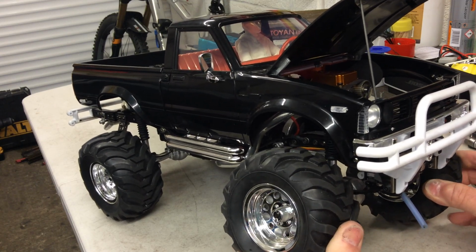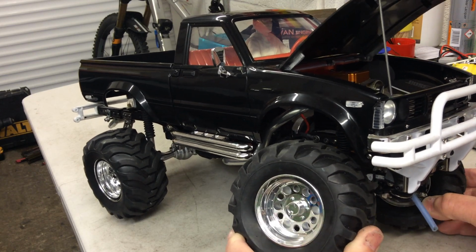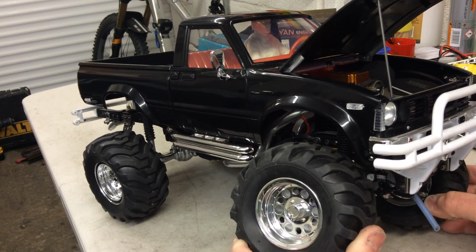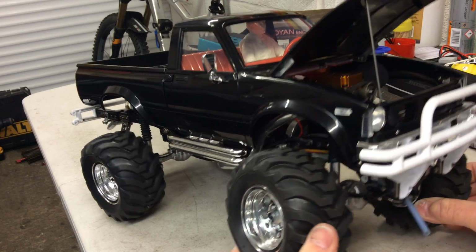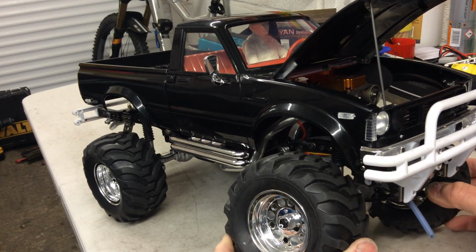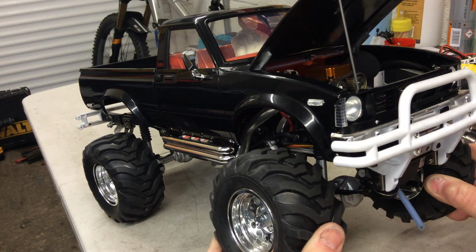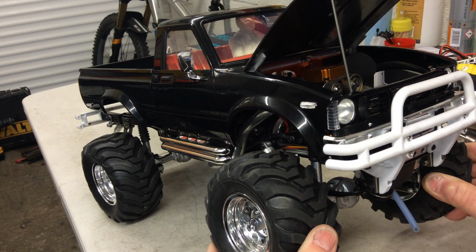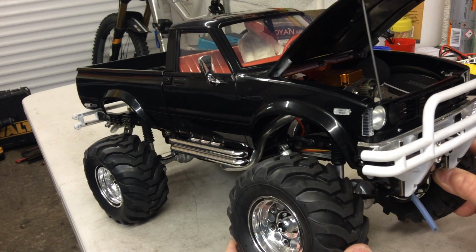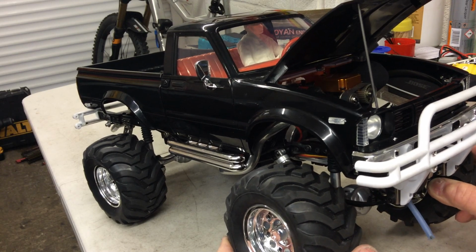But you know, you've got such a wide axle here, it limits you a bit on what you can do. But I've had a look at some wheels, and I think if I can make an adapter, if you've got a wheel with quite a lot of offset in it, so it's got quite a lot of dish on the inside of the wheel, you can come over about, I reckon, 12 mil. And if you've got a narrow tyre, you could probably come in more than that.